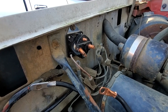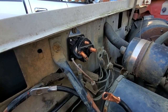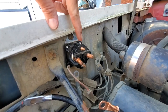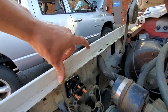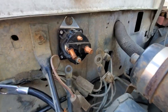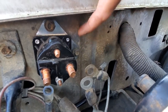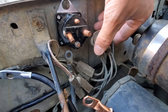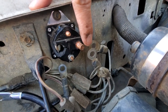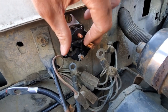Before we start the truck — I forgot to mention that when you replace the starter it's also a good idea to replace the starter solenoid, which is right here. It just mounts to the passenger side fender. It's real easy to replace — it really just has two bolts that hold it to the fender, and then a bunch of wiring connections that I've already undone. On my truck you can see my solenoid is falling apart.